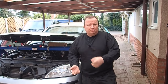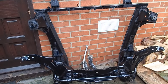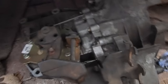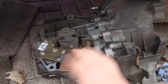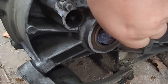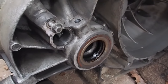Let's take a look at what we've actually done. There she is — those of you on my Facebook Retro Restore group would have seen me post a picture of this yesterday. It's all back on now with brand new bushes. Here's the gearbox, I've given this a bit of a clean — it was literally caked, you couldn't see any of the gold plating. Now I need to remove the driveshaft oil seals, prising the old ones out with a big lever or screwdriver and popping the new ones in.